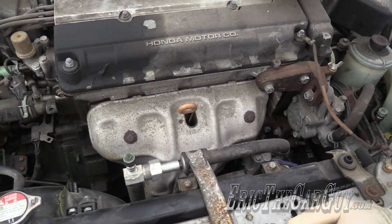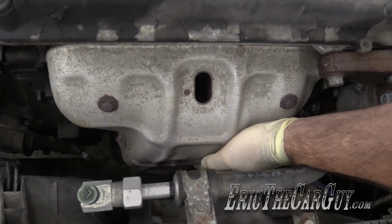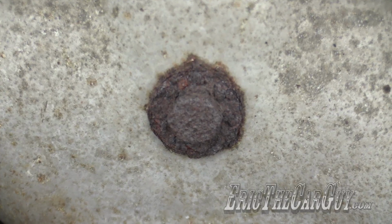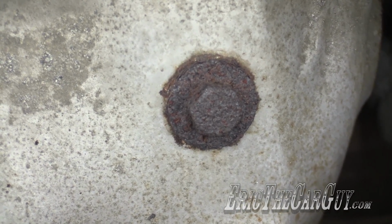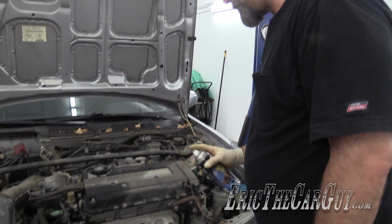Here's the old manifold. We'll first start by removing the dipstick. There's 4 fasteners that hold this heat shield onto the outside that I'm going to get first. They all start out as 12 millimeter, but after they rust for a while, you might be guessing to figure out what exact size they might be. We'll start with 12. Super breaker of rust. I'll link it in the description. I've been finding it works pretty good.